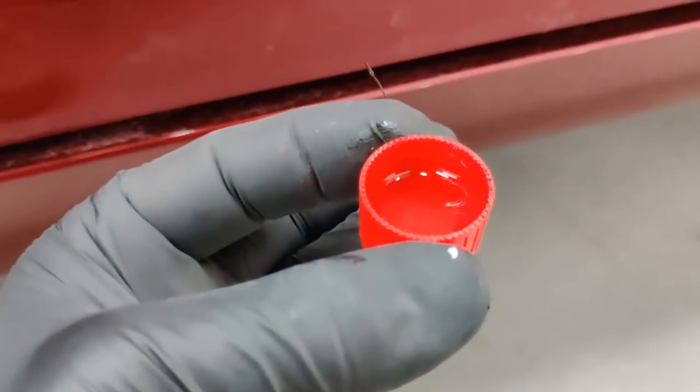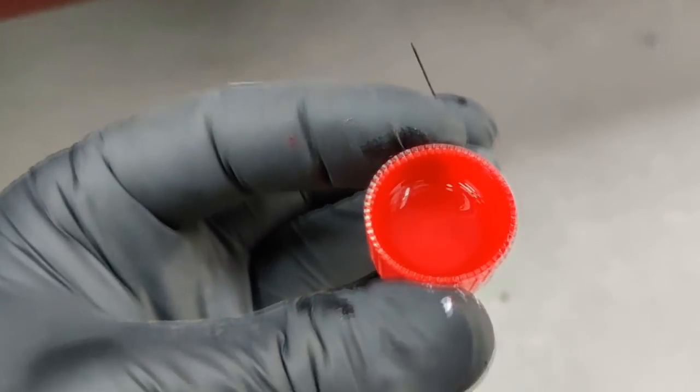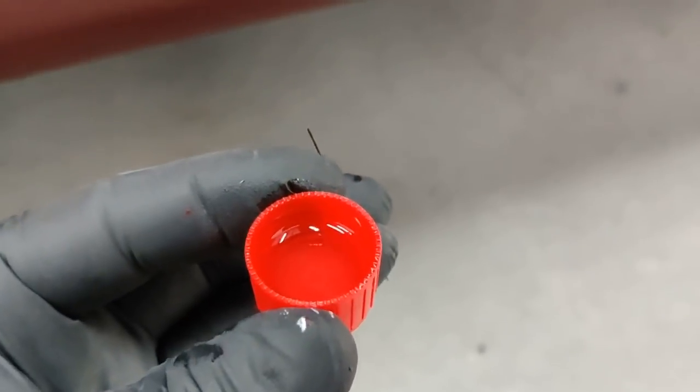Continuing. Two layers of paint applied, trying to stay within the edges without going over. Because the shape is such that you can't trim anything here. Now the lacquer is mixed. This is Maxitone lacquer — number 38.00. What I like about it: it's fast, natural drying for polishing in 40 minutes, and it's completely transparent. It's one of the few fast lacquers that are fully transparent, and it's also affordable in price.